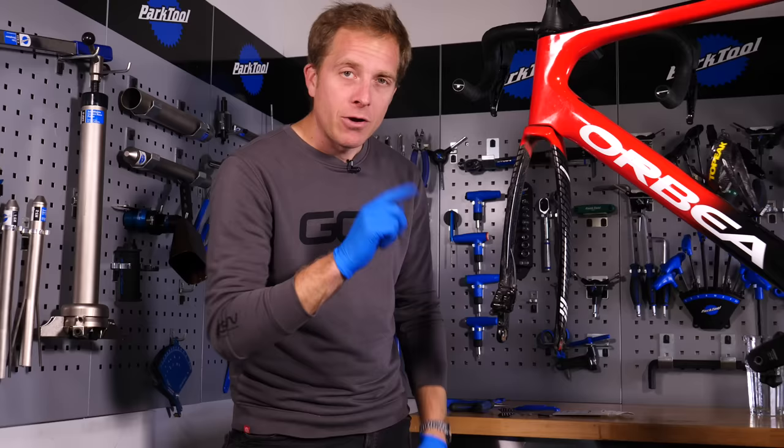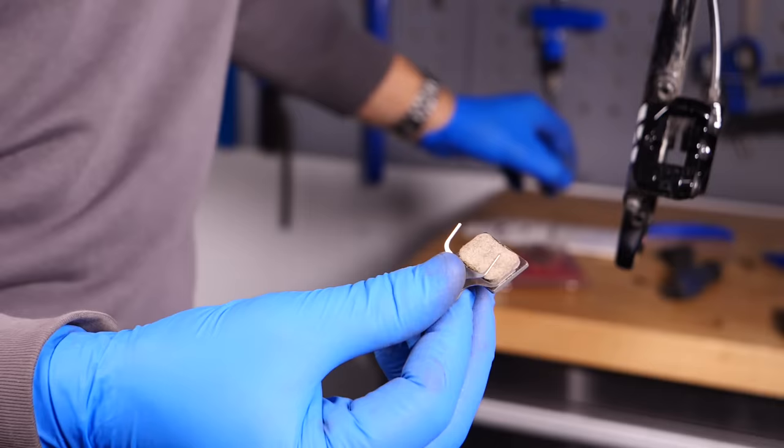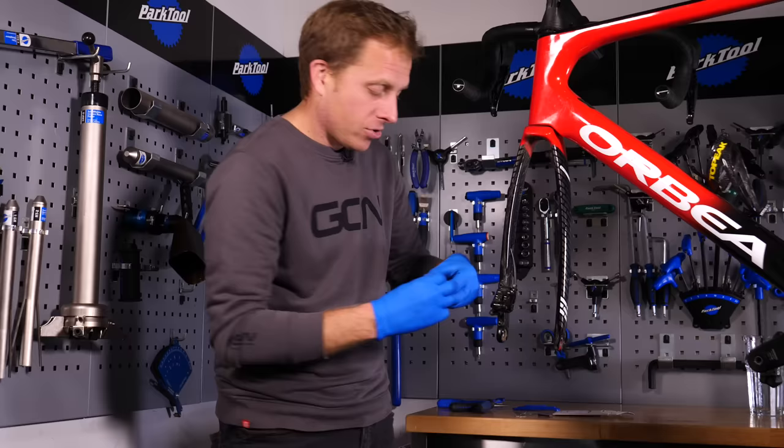Ollie can clean his own bike — I'm already doing this for him. Now, this metal spring here sits in between the pads, and it's very thin — about half a millimeter. What it does is make sure the pads spring back away from the rotors after braking. The caliper does that job too, but this is a secondary measure to ensure the pads retract from the rotor.